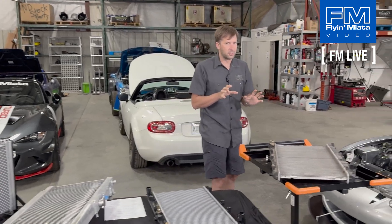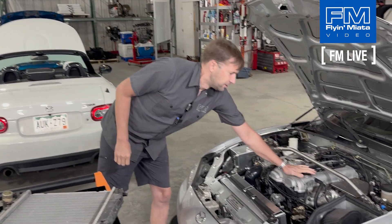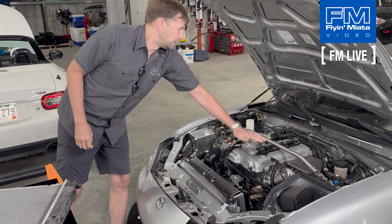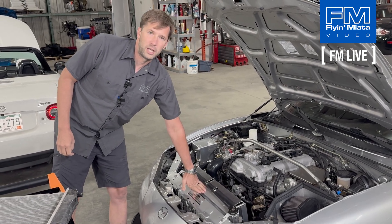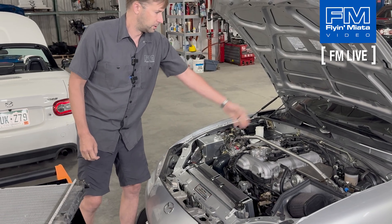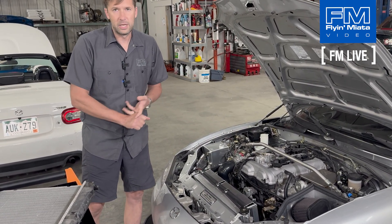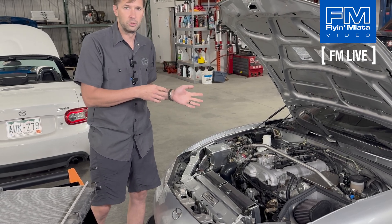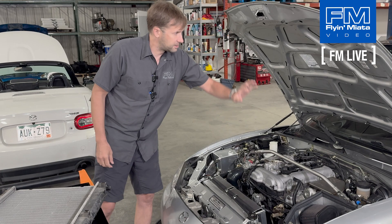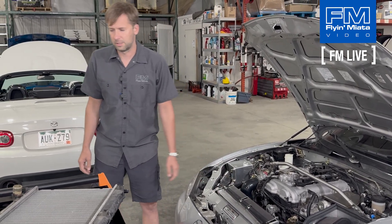We're going to start off with a quick overview of cooling. We've got a bunch of videos on YouTube that go into a little bit more depth with this, but generally speaking, this thing makes a lot of heat. We need to transport the heat to something that will shed it. The reroute helps with transportation, the coolant mix and radiator cap helps with transferring heat to the coolant, and fans, vents, ducting, and radiators help with shedding that heat as much as possible.